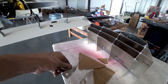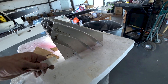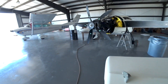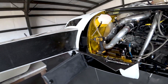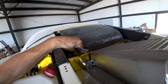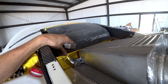Welcome back. Starting out the week, I'm working on mounting this intake baffling to direct air into the intercooler and also the radiator. Making some brackets out of 6061 aluminum — two on the front and two on the back — and they're just going to bolt up to the existing bolts on the radiator and the intercooler.